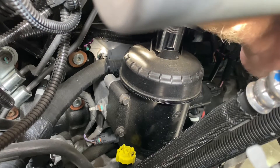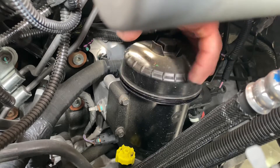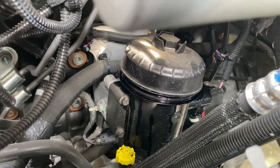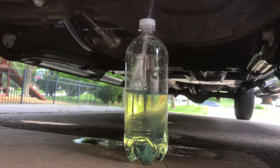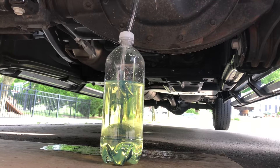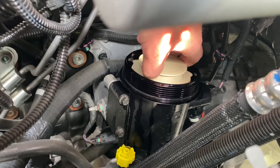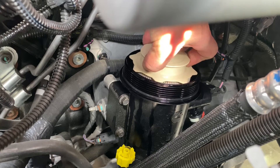It's got an O-ring on there that's pretty tight, so it's a little difficult with the angle that you have to get, but once I have it loose with the socket, I can get the rest of it off by hand and remove it. You'll see that more fuel has come out and some of the residual has dripped down as well. The bottle helped somewhat, but it didn't take all of it. We can remove the cap, and then pull the filter out — it's a slight turn and then pull it straight up.